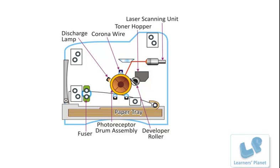This image or pattern is set on the drum. The drum rolls over the toner hopper, which gives a fine black powder. This fine black powder coats the drum. The black powder has a positive charge, so the toner clings to the negative discharge areas. The laser beam erased the positive charge and drew the images of letters, giving them a negative charge. The toner powder clings to the negative charge but not to the positively charged background.